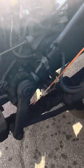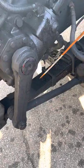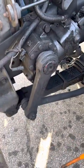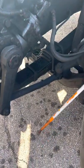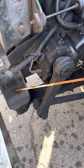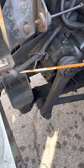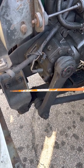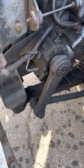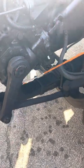The third part is suspension. Suspension has front suspension, and we also have rear suspension. We also have trailer suspension — that's why I say front front. This is mounting bracket or spring bracket. You need to check all the bolts and nuts — it has to be tight and secure. No damage or crack on the mounting brackets. This is leaf spring — that's what we call it.